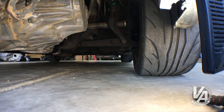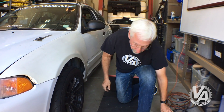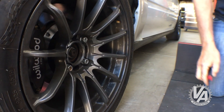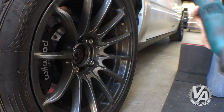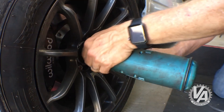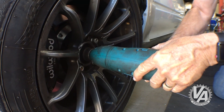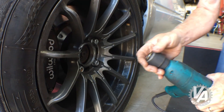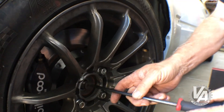Let's start — we're going to jack up the front of the car until the axle is parallel with the ground. That's the point at which the axle needs to be the shortest. Step one is to go ahead and get your center caps off. Our next step is to remove the axle nut. Now that we've got that out, we want to compress the axle all the way.